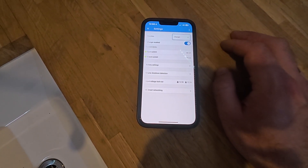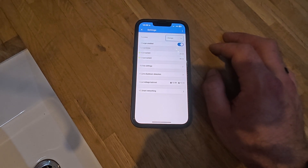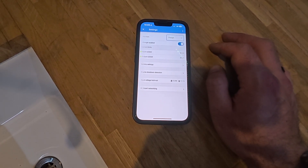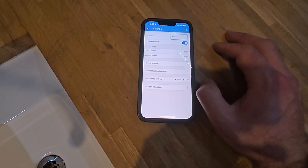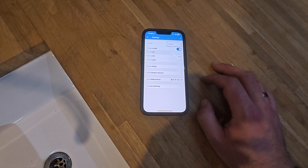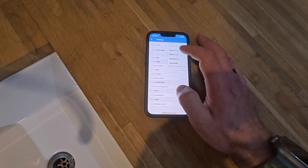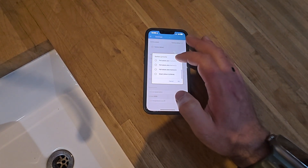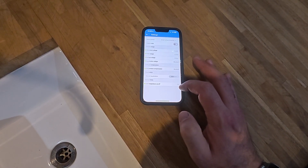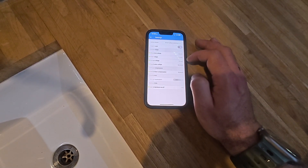Make sure your cable is correctly sized. If you've replaced an older 18-amp Orion, verify you have the correct cable size. For up to 50 amps, 16mm cable is absolutely fine provided the cable run is a suitable length — I'll put a link in the description so you can use a voltage drop calculator. In battery settings, select presets; for me it's a lithium battery, so I'll select smart lithium, which sets the low-temperature cutoff based on battery temperature.